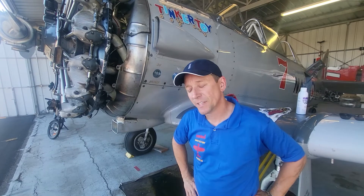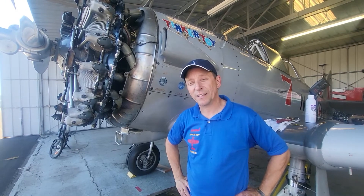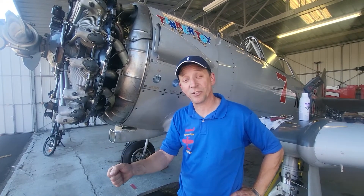We were talking about manifold pressure on a T6 engine and the proper definition escapes me because it's been a long time since I was actively flight instructing. But basically the way you operate an aircraft engine, you have two handles in the cockpit — one for your throttle and one for the RPM. I think of the RPM like a transmission: pick a gear, and that sets the RPM of your engine.